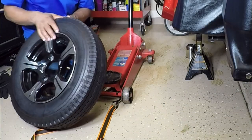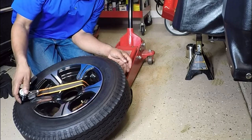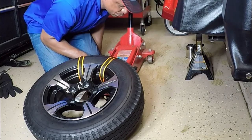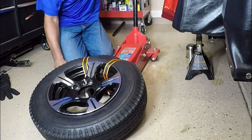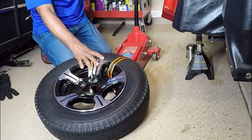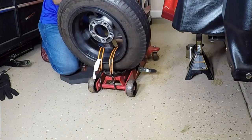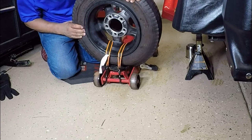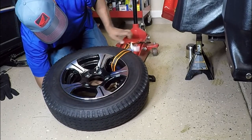The toughest part about removing a tire from the rim is breaking the bead. To assist in this process, I took a floor jack and two ratchet straps and strapped the rim to the floor jack. I made sure the part of the jack that presses up would press on the tire and not the rim, so it would break the bead. The bead broke quite easily — I hooked the straps on the bottom of the floor jack, fed them through the wheel, and ratcheted them down. When I pressed up on the rubber part of the tire, it broke the bead. Very simple but very effective.